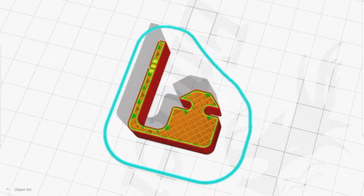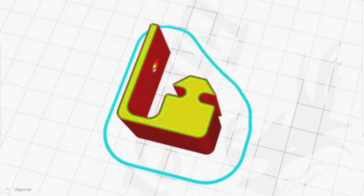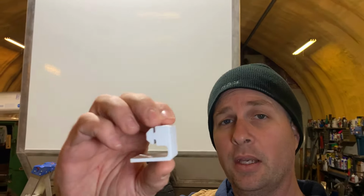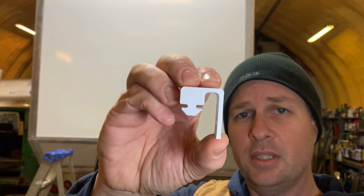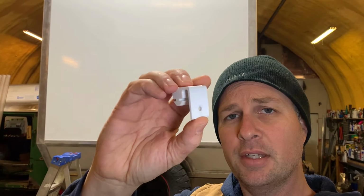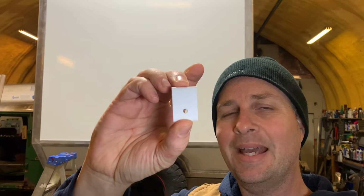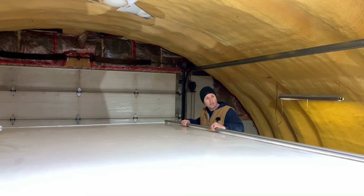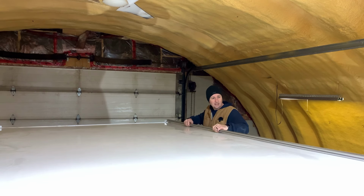I imported the model into my slicing software to create the G-code, and then my Ender 3D printer took over and created the part out of PLA plastic in about half an hour. After printing it out, here's what we end up with. We've got the shape of the T-slot, and then it comes up, over and down again, and on the side we have a hole that lines up exactly with the center of where the side groove would be on the T-slot. And basically all I need to do at this point is get this in the right place up against the side